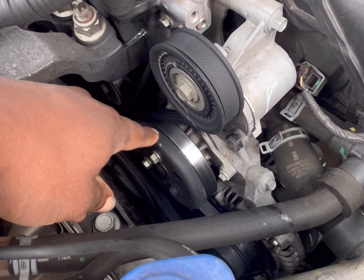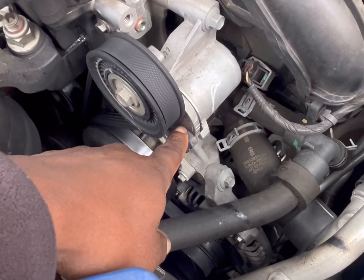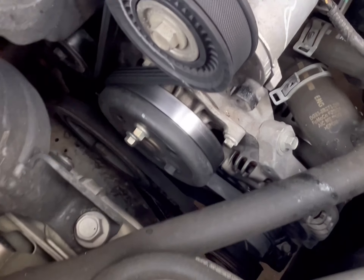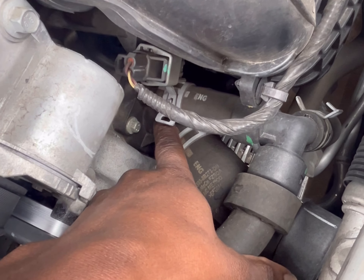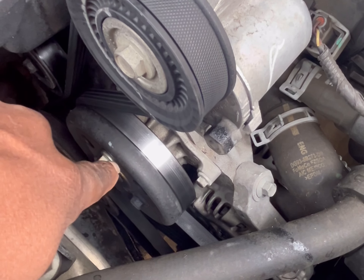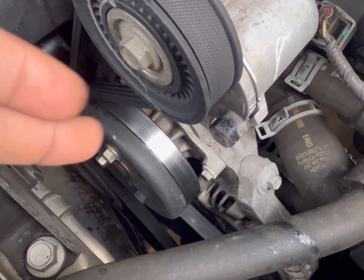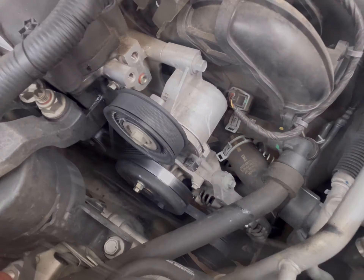What we're going to have to do first is break these bolts loose on the front of the pulley, then put a nut on this tensioner to release the tension from the belt. This will allow us to slip off the belt from the water pump pulley. The thermostat is right here inside this little housing — three bolts on it. We'll start with the water pump, take the pulley off, remove the belt, unbolt the water pump, let the coolant drain, and then do the thermostat after.